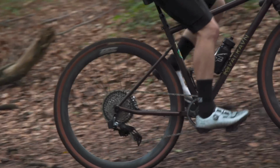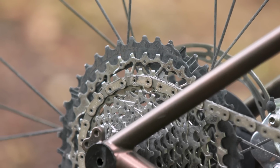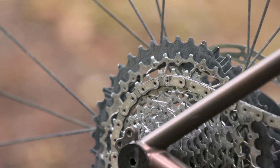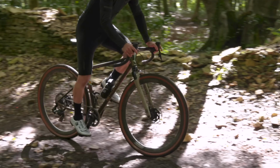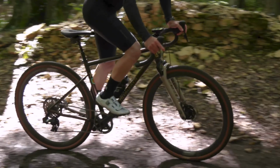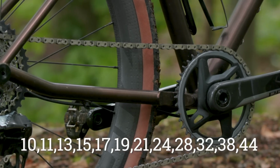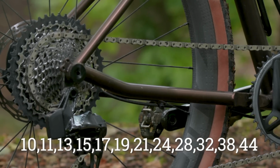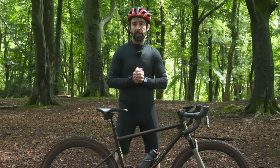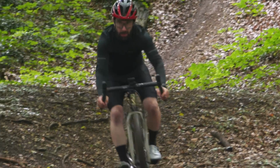The centerpiece of the XPLR drivetrain is the new 10 to 44 tooth cassette. SRAM claims it's been testing gearing options with their engineering team and sponsored athletes for over a year to try and nail down the ideal spread across such a broad cassette. And if you're wondering what that spread is, you'll be able to see it down below. As you can see, the tooth jumps between the gears compress as you run down the block. SRAM said, following on from feedback from riders using a mullet setup, that the jump from 10 to 12 teeth was too noticeable on flatter, fast sections.